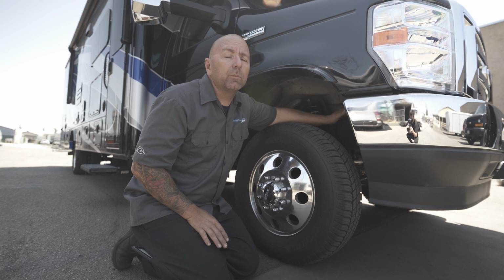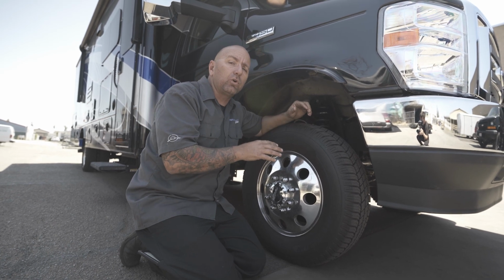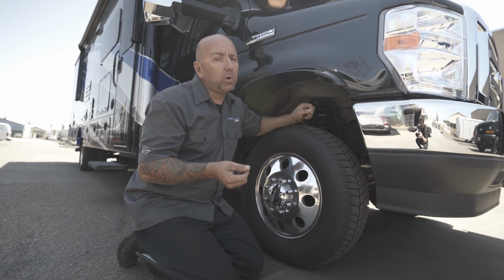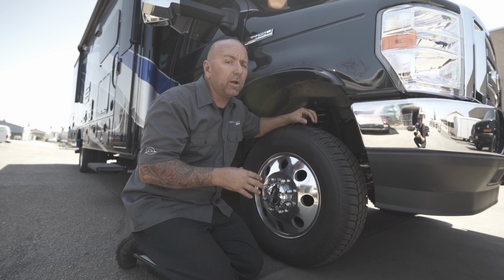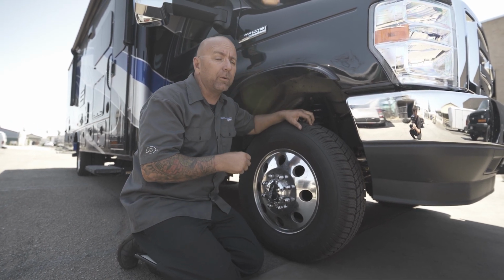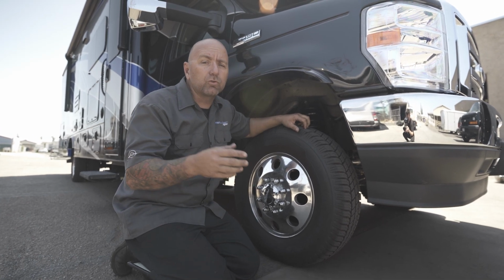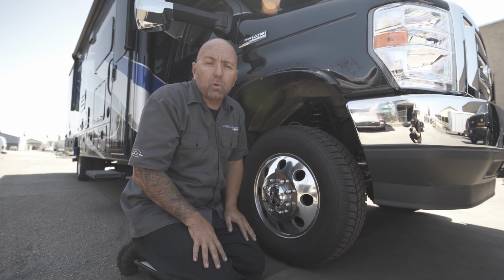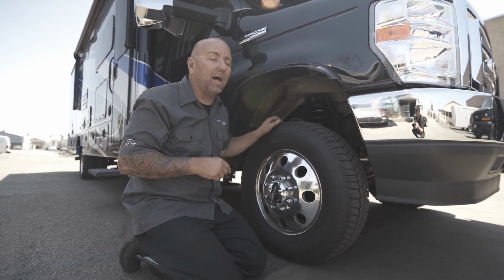We've also just used some blocks to drop down the sway bar in order to keep all the sway bar control. Now, what is also a big plus when you go to this kit, we aren't running a heavy duty sway bar, and honestly I feel that the kit works better without the heavy duty sway bar in the front end. Obviously that's going to be up to you and your driving, how you like your vehicle to handle, but overall I'm a big fan of not having it.